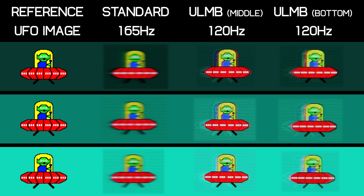One key selling point for the XG270QG over the 27GL850 is backlight strobing for improved motion clarity — but is the feature any good? On face value it's quite limited, only functioning at fixed 120, 100, or 85Hz refresh rates with G-Sync disabled. The actual implementation is poor — there's significant strobe crosstalk and even a chromatic split causing a red tint to the fringes of moving objects. This is due to a slow red phosphor in the backlight used to support the wide colour gamut on these Nano IPS panels. This limits picture quality with backlight strobing enabled, and it seems this wide gamut panel is simply not compatible with backlight strobing — which would explain why LG neglected to include the feature with their version.